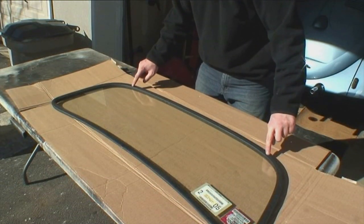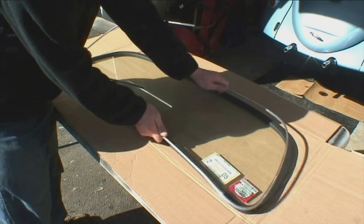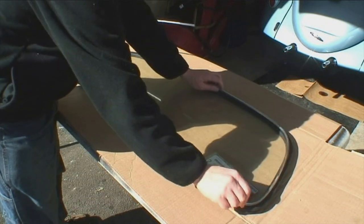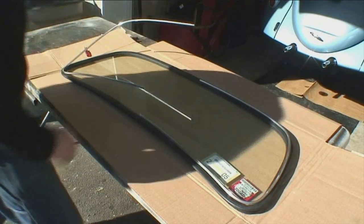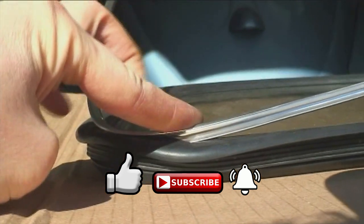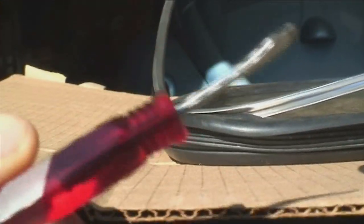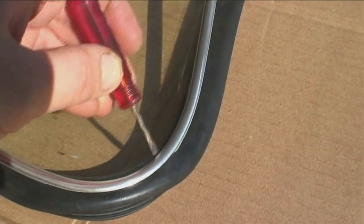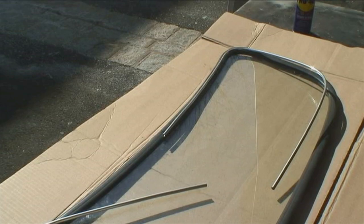Now we're going to get the chrome that goes into the groove in the seal. Some of the chrome kits — the chrome is sometimes a little too narrow, so I'm just kind of opening it up a little bit more so it's even with the window. The front windshield actually has two pieces that go in for it, and usually they give you the clips as well. I usually start on a corner and you're gonna have to pull back the flap and try to work it into the groove. Sometimes you might need a little screwdriver to pry the seal — sometimes you get the front part of the seal over the chrome, but the back portion in the corner is not flapped around.